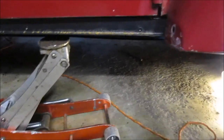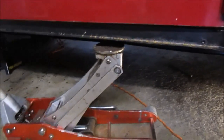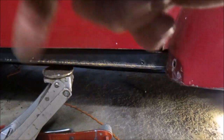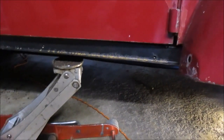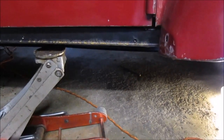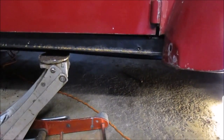So we just need to clearance a few more things in the front and the back, but the fitment underneath is real nice. Looks like it's going to fit in there. We're going to need to punch some holes in the floor pan on the inside in order to spot weld it into place, so we'll be taking that apart at least one or two more times. We'll prep the area to be spot welded and prep the area of the pan to be welded into place. I'm very happy that we ended up getting some bolts in here so everything stays lined up.